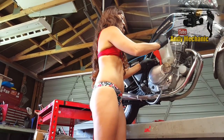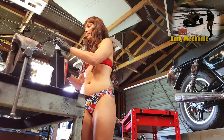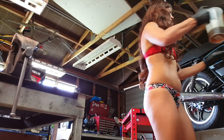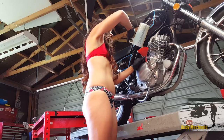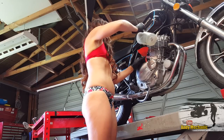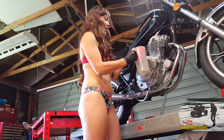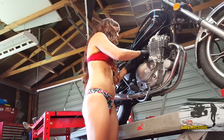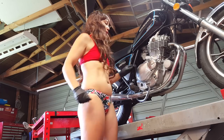Have you finished? Yep! 300ml - perfect. You can come back again and I'm going to screw this back on. Pop that back on - it only needs to be finger tight, it doesn't need to be tightened up with the pliers. Okay, you can lose the gloves now. I reckon we've got enough oil in there, but we're going to check it properly.